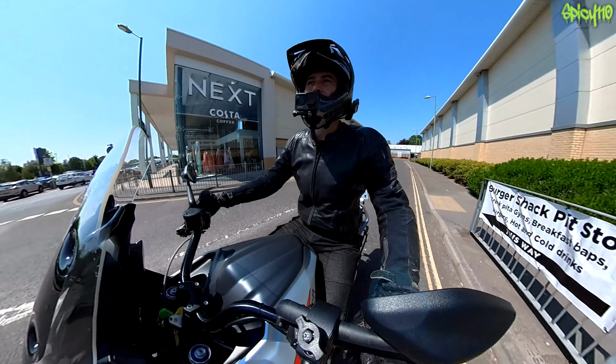Okay, well, let's start at the front. So we've got a 120/70/17 front tyre, that's a Pirelli. The rim is OZ Racing. Sorry, if you want me to say OZ Racing, it just doesn't sound as good to me, but whatever. We've got 330mm Brembo discs. Well, I assume they're Brembo discs, Brembo brakes. 330mm discs, which are huge. And four-pot Brembo calipers, so we'll see times two. That's why this bike has got so much braking force.